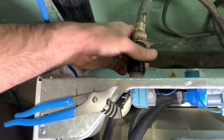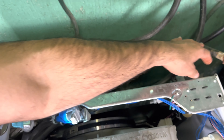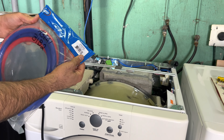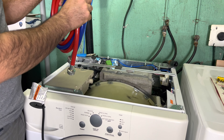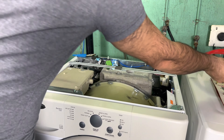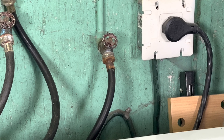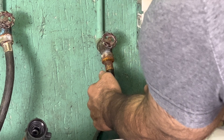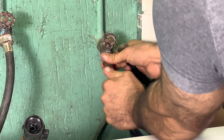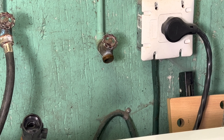I've stopped it and I'm going to run it on the heavy cycle. On heavy cycle we get cold and hot water, so this time you're going to see how the hot water flow looks. I'll press it on and stop it if I'm getting a lot of water on the floor. It's flowing a lot of water, and the cold water should be similar or a little bit more. I'll try it again on delicate — that's cold.